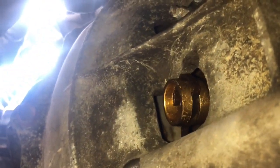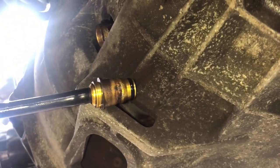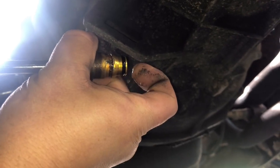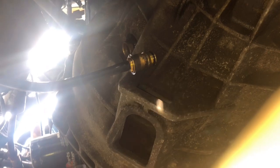Hopefully there are no other problems. These lines have a valve in them so they won't leak fluid if they pop out. But if I press down on the valve, fluid will come out. That's why his pedal is so stiff. Let's put this clip back in and see what happens.